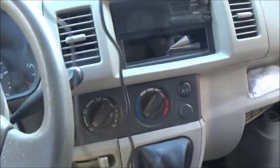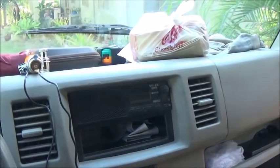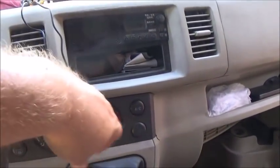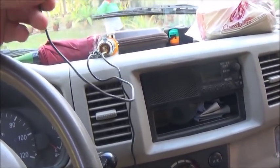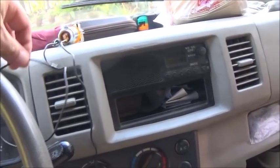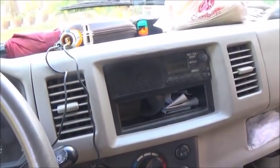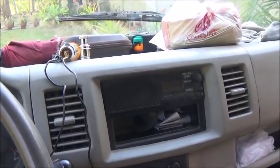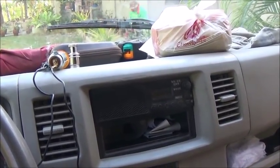Now for all those of you saying we've got to use a great big huge wire — bigger wire is always better. But this is the stock wire that came with it, and this is maybe 16 gauge. Even though electric cigarette lighters do take a lot of power — 30 amps or so — it's just intermittent. It's only for 5 or 10 seconds.